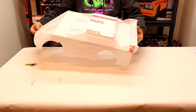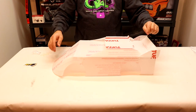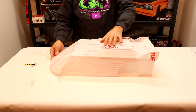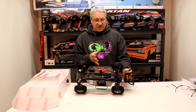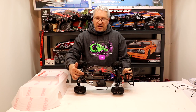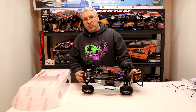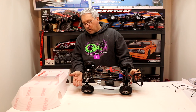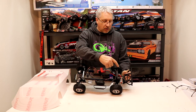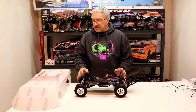We only have a couple bolts holding everything in place, but you can see what everything looks like all together. Now is when you want to mount it on top of the chassis so we can drill our body mounting holes. Make sure everything fits down into place before we remove all the protective plastic and paint the body. I'm using the stock Traxxas Slash — on the back I have the stock rear body mount, and up front I have the stock front body mount with the stock crossmember. On the very front of the car I did take off the stock front bumper because I'm using one of these small turndown bumpers. I may use this car as a Mud Boss car also. You can also take off that front bumper, flip it upside down, and it makes a great body brace for these late model bodies. Up on top of the post, I did mark the post with a white marker so you can see it easier when shining through the body and lining everything up.